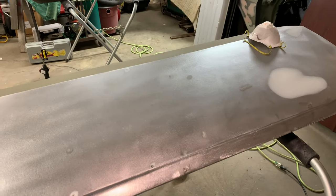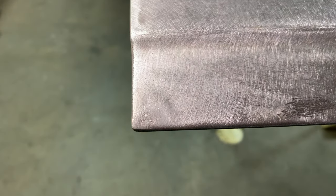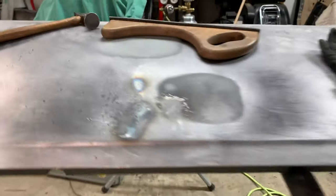You can see why I've been using the drill bit to etch out any imperfections or rust. I have a few at the bottom of the door there — I took the wire wheel and went over places I already got, and that shows the rust clearly. You can see how pitted it was — it's pretty bad in spots and will need a little touch-up work. It's a very tedious job that takes a lot of work, and that's basically what we had to do on the entire car. Stepping over here, you can see dad is still dealing with high spots, and I can already see some rust there too — we'll have to do the same treatment to that door.